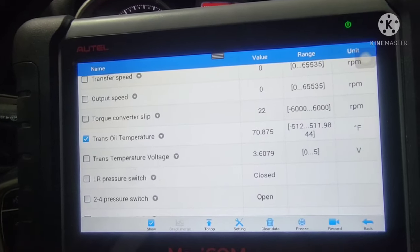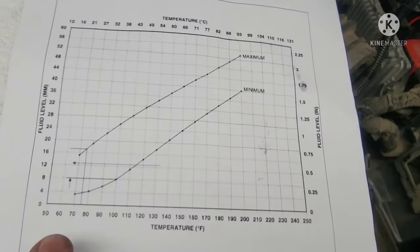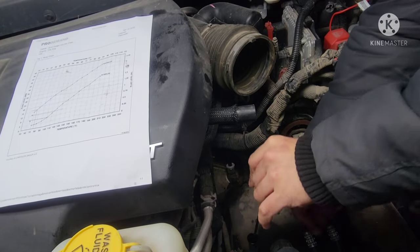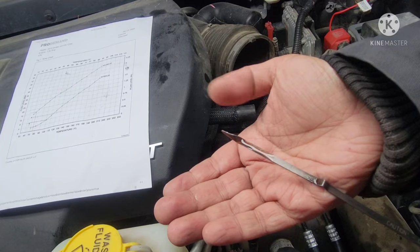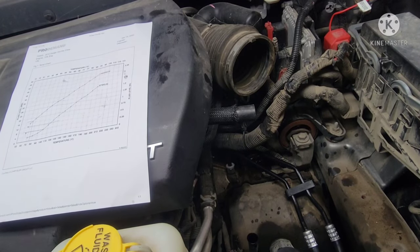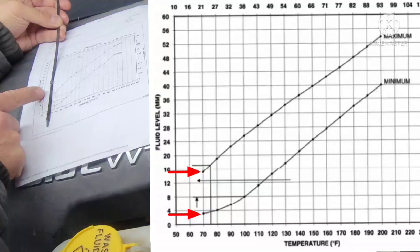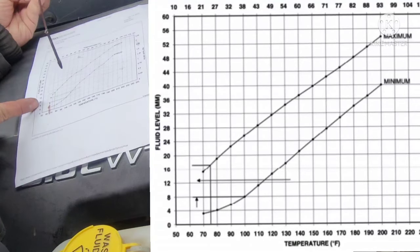It's on park right now so it's going up, so let's go back to the chart. At 70 degrees Fahrenheit, let's put that dipstick in and see what kind of reading we can get. Looking at the dipstick, you can see it's in between the two marks — right in the middle. Back to our chart: maximum is on the top, minimum on the bottom. Line up the marks on those two dots — top and bottom — and the oil mark is right in the middle, so our fluid level is right at 8 millimeters.